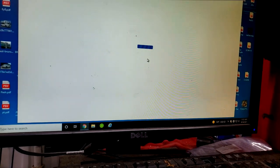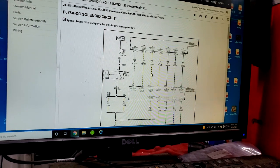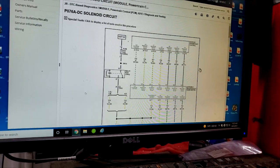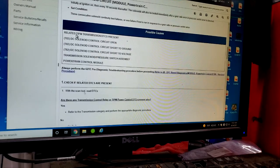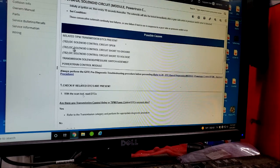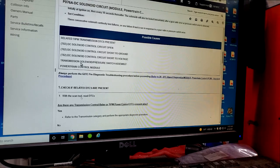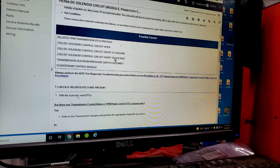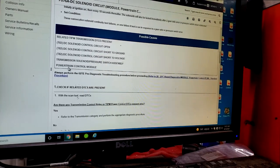So one would think, well, JT, why record it and show us? Because some guys may want to see it. I don't know, may want to watch it, but it's no big deal. Like this code here, this is a P076A. Possible cause, a lot of people go straight to that. Yeah, this could possibly be the TIPM. However, I doubt it, because I actually have an internal transmission issue based off the fluid as well as the code. Short to ground, short to voltage, solenoid pressure switch assembly. That's my problem right there, guys.